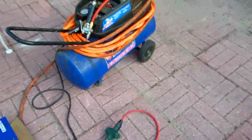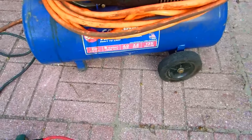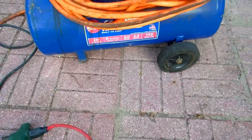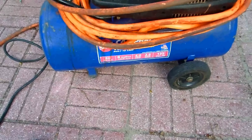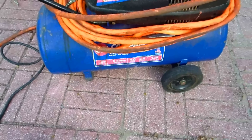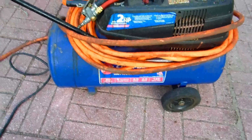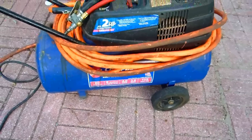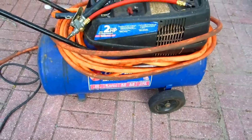I'm gonna try it out with this little compressor, which I know is too small — I'm gonna get a bigger one. This sandblaster is rated for 9 CFM at 90 pounds. This one is 2.6 CFM. I'm either gonna get a 220-volt at 11 CFM at 90 pounds, or a 120-volt at 5.6 CFM. The 220-volt has a 60-gallon tank and the 120-volt has a 30-gallon tank.